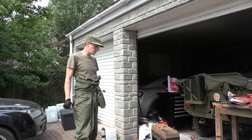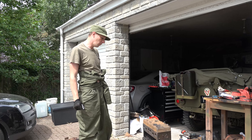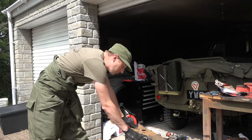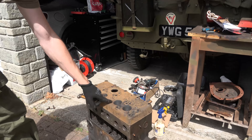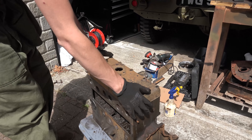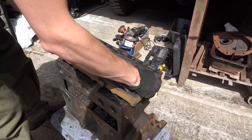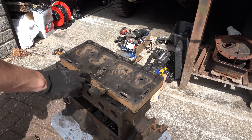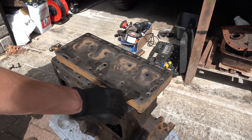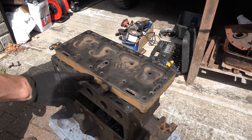So guys, we've got them all apart and it's gone pretty well - as well as you could expect really for a rusty old Jeep block. We've had some failures but we'll have to look at that. The first thing is the head has been acid dipped and you can see it's not completely done but it's starting to rust already because that's how good the acid is - it takes it right back to base metal. The head itself is looking all right. These areas here don't look like they're going to impinge on where the cylinders are, so I think this might be okay, but can't be 100% sure.